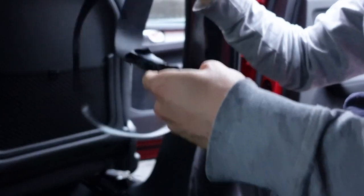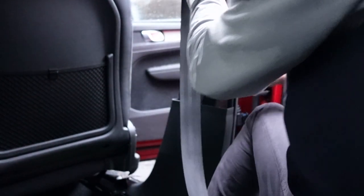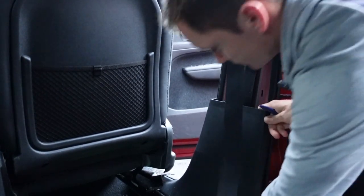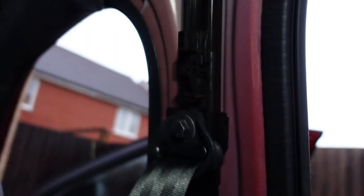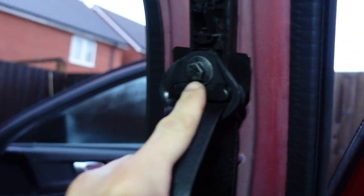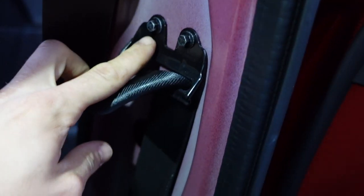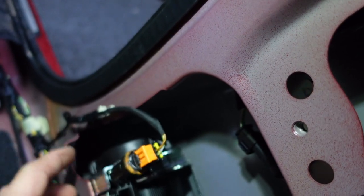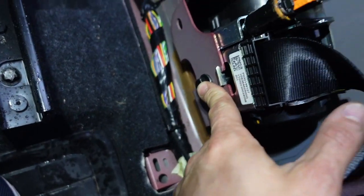I'm not gonna send this one. So I've got the bottom of the seatbelt. Now I need to undo those two — this one is 13mm. I'm gonna first remove the trim, remove the bottom trim, which should come out. So you've got 13mm here which I'm gonna take in a minute, then you've got two 10mm. Then you have the seatbelt there which has one of the sockets — you lift up the orange bit, and that's the crash sensor, and then it just slides out. And then you've got 13mm over here. So what I'm gonna do now is disconnect the battery — two of them.